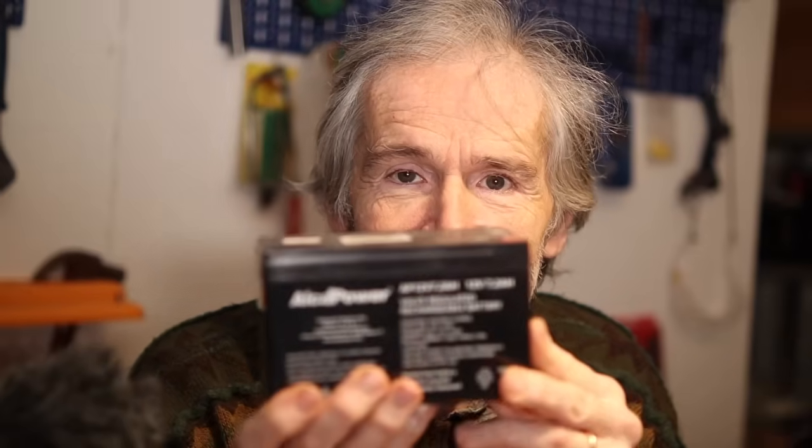At the time of writing this script, I expect to have eventually a prototype of the car booster at a small scale, which can still be used for pretty high currents of some 12-volt devices like an air compressor to inflate your tires, or a cool box of 40 watt. Also, the battery is much smaller, but anyway of 12 volts. By the way, it is 7 ampere hours, and that is 7 times 3600 seconds, so we are above 25,000 coulomb, much more than those 1500 coulombs which we calculated is necessary for starting. It would really be interesting to see if the Toyota RAV4 can start with this small battery.